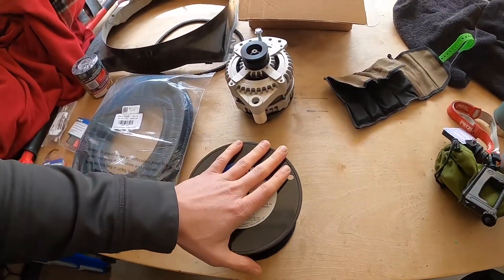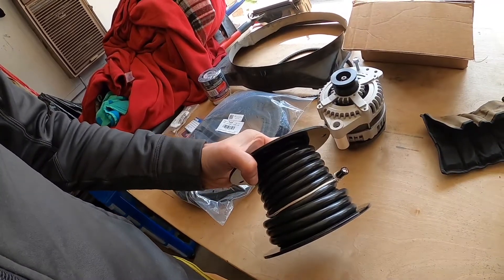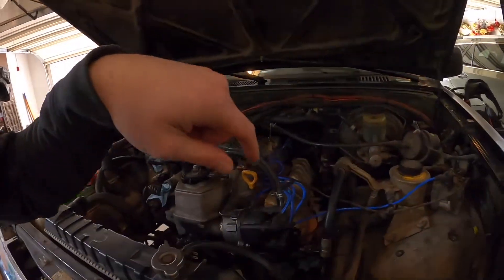In doing an upgrade like this, especially going from — I think the factory alternator is rated at 60 or 70 amps, I'm not sure — I was having issues charging my second battery system, particularly when doing a lot of four-wheel drive, low RPM stuff. The idea behind this is that it will charge at a higher rate when the vehicle is idling or close to idle. So going from say 60 amps to 250 amps, we have to upgrade the wiring, so we've got two-gauge wire here.